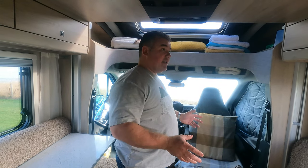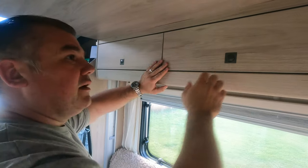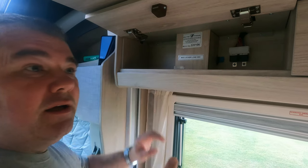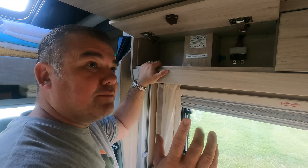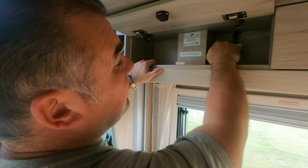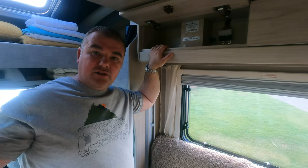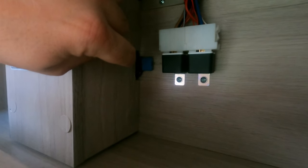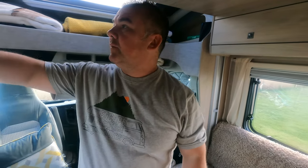It's worth noting that if you've got duvets on the bed and you try to pull the bed back up and you keep pressing the button, it'll trip out. One of the things that trips out is a little fuse. It baffled us on one trip — we thought we'd blown everything, went outside and changed all the fuses, but nothing responded. What had happened is there's a little button on the side that clicks out — you just push that back in and the bed will operate again. Apparently these beds don't go wrong very often; if it does, it's generally just a fuse.